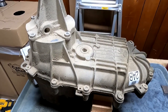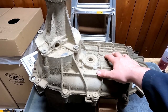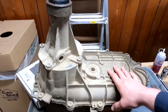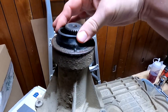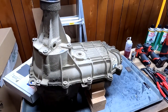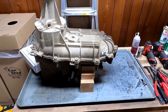This is the variation of the 1356 I'm going to be demonstrating, and this transfer case has just shy of 250,000 miles. That's generally about the benchmark - the point that you'll want to do a rebuild - because as you can see, the rear seal for the slip yoke is not in good condition and she's leaking a little bit. With the mileage that it's at and with the rear seal doing its thing, it's high time for a rebuild. I've done this a couple of times before - it's actually not difficult, so there's no reason to sweat it.